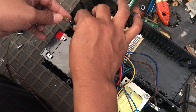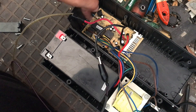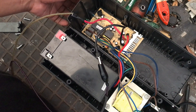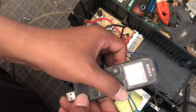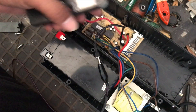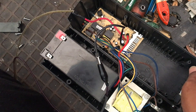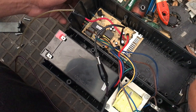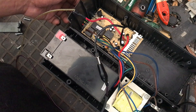To make sure whether the battery is normal or not, we have to open the case of the UPS, remove the cable connected to the battery, and connect it to a 12V voltage source — we can take it from an adapter with the voltage set to 12V. After that, try to turn on the UPS without connecting it to a power source.